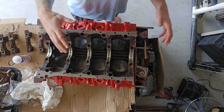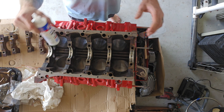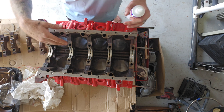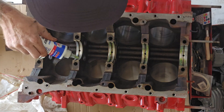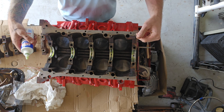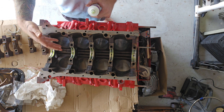It's a week later. I've got a cold beer and it's time to start laying this thing down, get the bearings back in, everything cleaned up really good, and get the crankshaft and the rotating assembly put back together. Everything is apart and I have the bearings in, so the next step is to put some assembly lube on all the bearings, get the crankshaft out, make sure the journals are clean — it's been stored in a bag. After I make sure the journals are clean I'll drop the crankshaft in, put the caps on, get everything torqued, and then get ready for pistons and connecting rods. It's good to be generous with the assembly lube because that is what's going to protect your bearings and journals until the oil pump starts pumping oil into all the nooks and crannies.